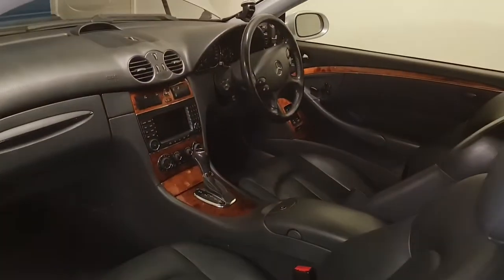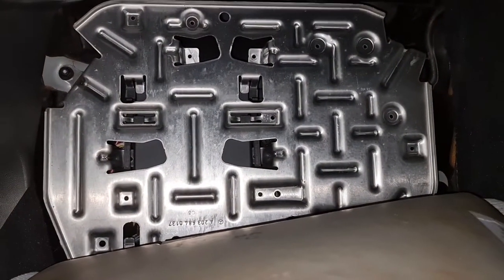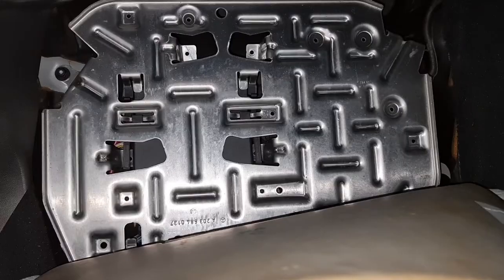Here, this is an Australian car, so it's a right-hand steering car. This is the passenger footwell. I've already removed the floor mat. So now what you need to do is just pull this away gently. Pull away and work it out, like that. And here's the foam over there. Just need to gently pull the foam out. And here we've got the TCU underneath that aluminium shield.